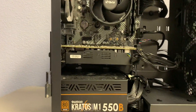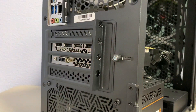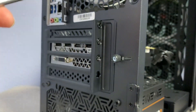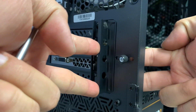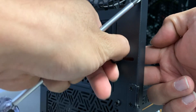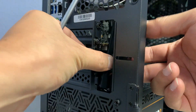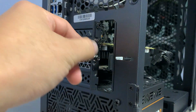First thing to do on a video card swap when you are using the Blaze 2: you will want to loosen this screw here that holds this slide that keeps everything in place. I'd recommend taking it all the way off — once you've got that screw out, push it in and set it aside. What holds your graphics card will be these two screws here.